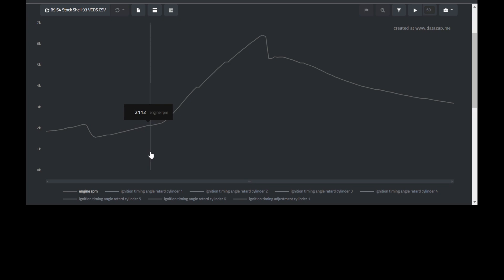With the file named and everything ready on VCDS, hit start, get back to it, make sure you're in third gear, get up to about 2,000 RPM, and hit it. One full gear all the way through — then come to a stop, hit stop on VCDS, pull over, and you can go over your logs.